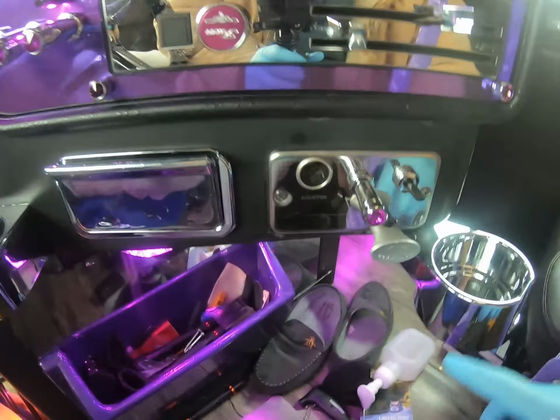I'm just bobtail, so you're not seeing me split the gears at all with a splitter. I'm just going on the high range and just 2x2. You can do that, especially when you bobtail. There's no need to split gears like that. The only thing with it is the RPM drop's got to be a little bit more than if you are splitting them, because obviously you're going up by two, essentially.